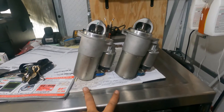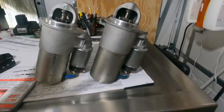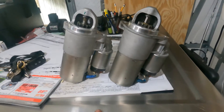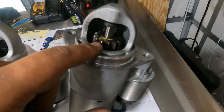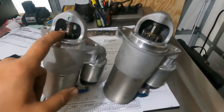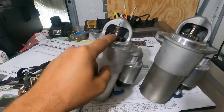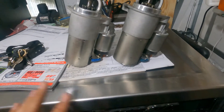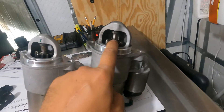So I was like, oh my god, what happened? There's a clue here because you can see I have two starters side by side — you've got the original here and the new aftermarket one here. If you look at them, they are identical — however there is one very subtle difference, and it's the pinion. The new one has 11 teeth and the original is supposed to have 13. Obviously that's why it bound up. So here's a tech tip: verify the pinion tooth count before you install it, because apparently there may be two different versions depending on the year or manufacture date.